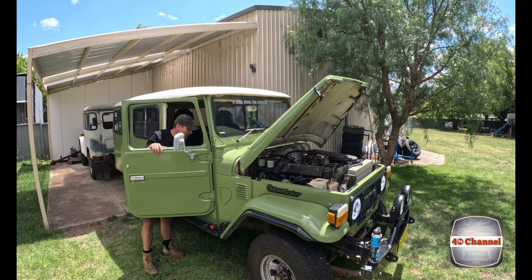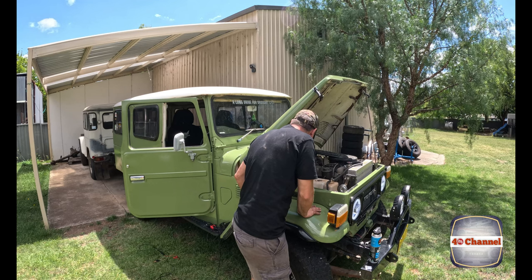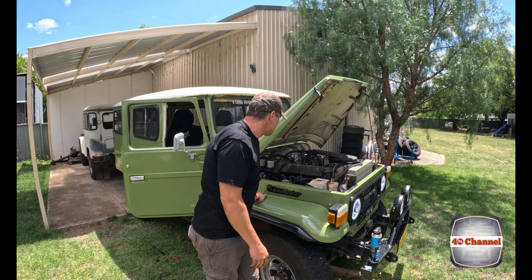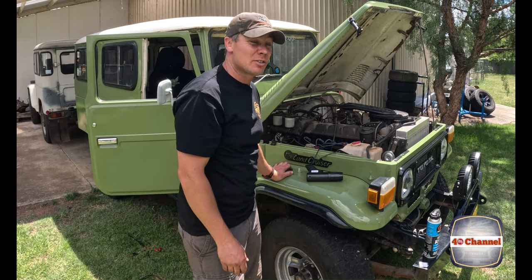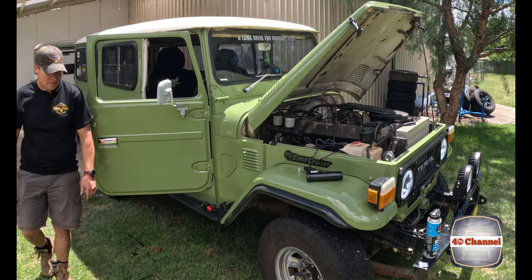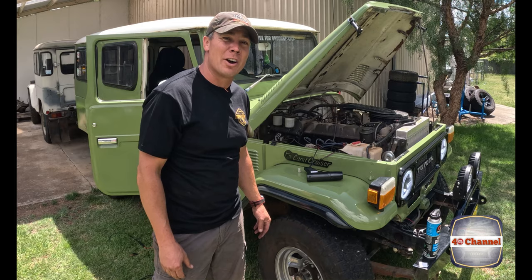I'm a little bit nervous — alright, let's give it a crack! Alright, something's not quite right there, but it started, so that's a good sign. Let's check our timing and see what that looks like. Our timing was a fair bit out, so luckily it's an easy fix — we just adjusted the screw and fixed the timing up. Done — look at that! Oddly enough, I don't know if it's just me, but it does sound like it's actually running a lot smoother. So anyway, we'll take it for a drive and see how it goes.